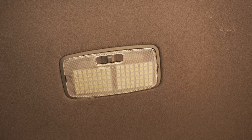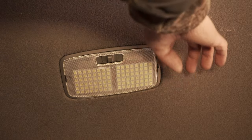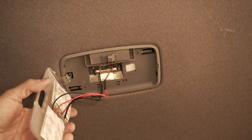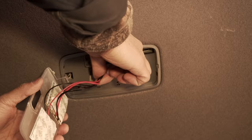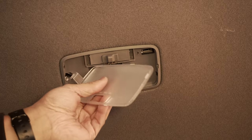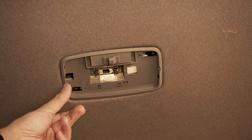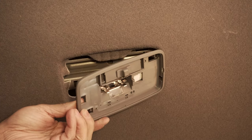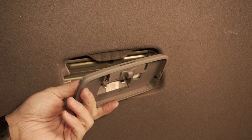Now let's work on removing the dome light. Mine is a little different because I have those LED panels — I highlighted them in one of my videos so check that out. This just requires a flathead on one side to pop it out. I'll remove the dome light itself and the panels — they're just taped on there. We can twist it 90 degrees and pop this cover out. Pull it out from the passenger side first, then there's a harness on the light to remove.